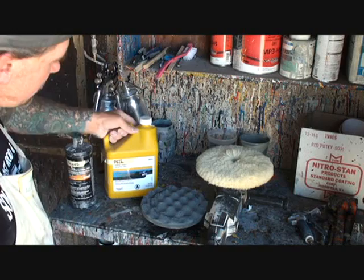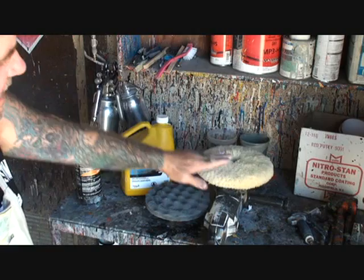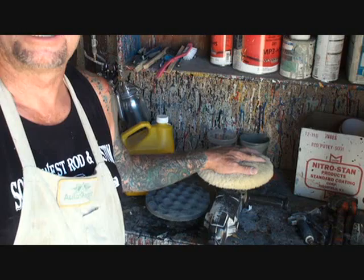That's what we're going to use to buff our panel — this applies to everything you buff on your vehicle or painted surface. If I was going to buff acrylic enamel or single stage, I'd give it a good buff with this, making sure I watch my pad as I'm buffing. If you see paint on your pad, that means you're buffing too hard — slow your speed down, don't put as much pressure, and move a little quicker. I don't want anybody to think the buffing I'm showing you is for all surfaces. This is for base coat, clear coat only.